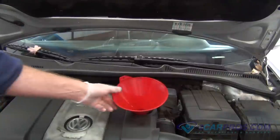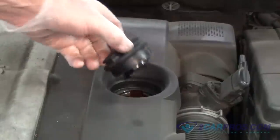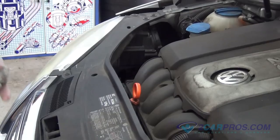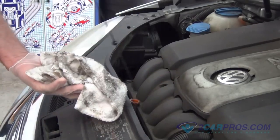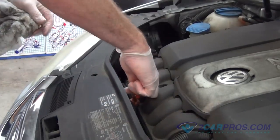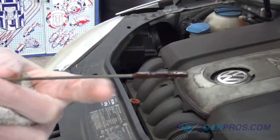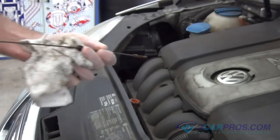Once you are done pouring the 6 quarts of motor oil into the engine, remove the funnel and replace the oil fill cap. Allow the engine to run 20-50 seconds to get a proper read on the dipstick. Then, with the engine off, remove the dipstick, wipe it clean, insert the dipstick, then remove it again to get a proper read. Add oil if it reads low. Please click our subscribe button and like us on Facebook. Thank you for watching 2carpros.com.